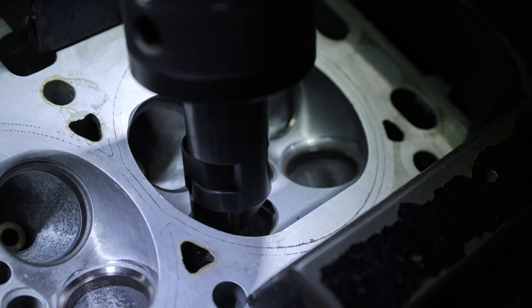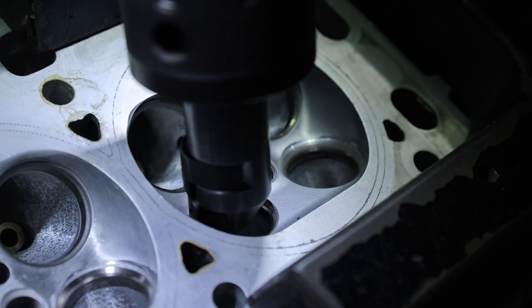A lot of people think that a valve job is just a valve job — you just go down the street, get whatever this guy is going to give you, and it's going to work. Well, it works, it seals, but it doesn't pick up the cylinder head, it doesn't pick up flow. And that's the one thing that Head Games Motorworks has over a lot of different shops — we flow test every single cylinder head, or every valve job that we use has been flow tested. We know it works, we know it doesn't work. You're going to have your base 45-degree angle, and then there's a top cut, a bottom cut, there's a throat cut. There is the widths of these angles — they're not all created equal. And that is one thing that you have to keep in mind.